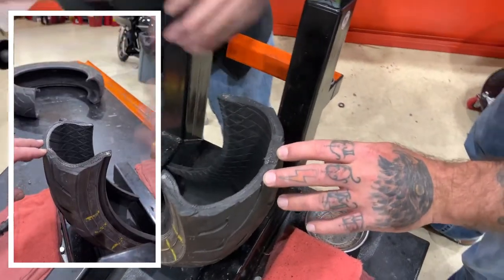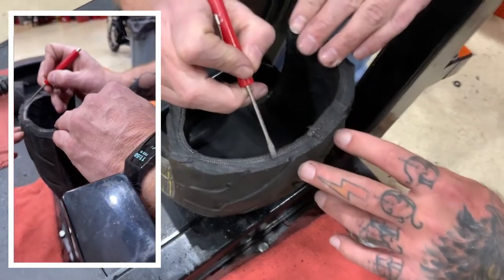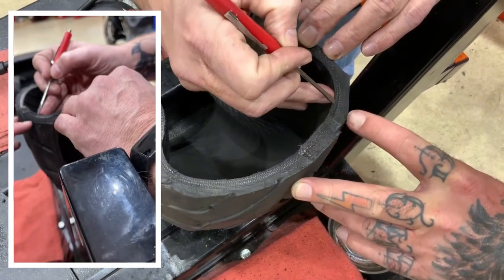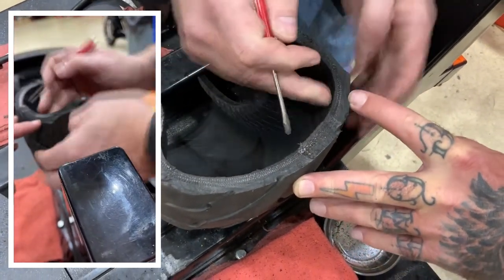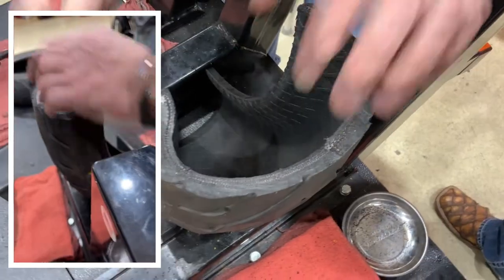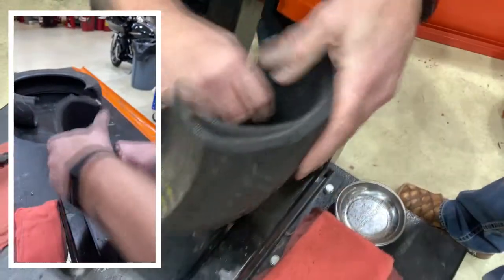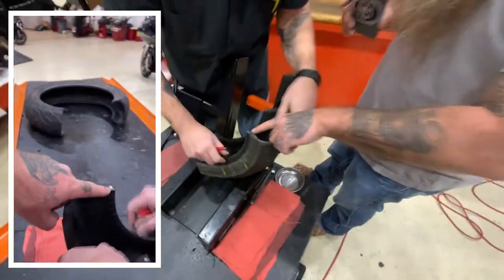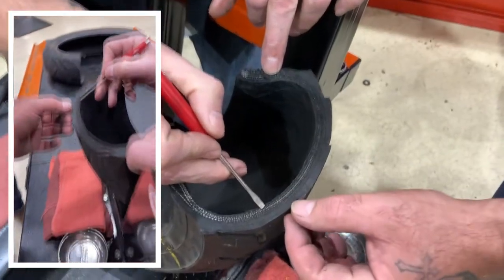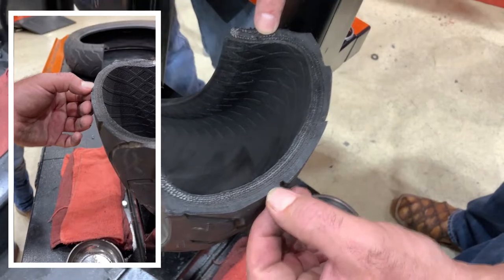It's being woven. It's really hard to see, but you just got to see the distance here, distance here. Then you're looking over here — the distance here, the distance here. And then obviously this is starting where the sidewall is, and this is where your issue is. See the difference in the thicknesses? And then you've got the difference over here. It's really cool to actually see that they care about the sidewall — look how much metal they have in there. Some tires don't have as much. But see the distance from here to here to here.